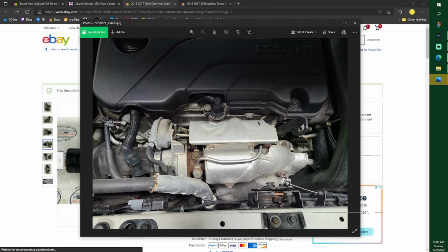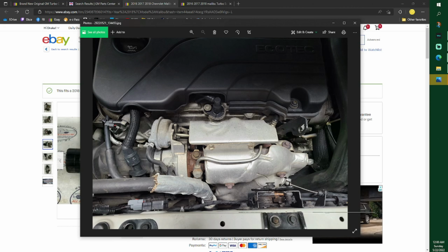And the whole problem I had with doing this entire car was this line right here, this AC line. It does not move. It may move a quarter inch barely. And also, you do not want to hit your sensors up here. There's a sensor on both sides. That is your airbag sensor. If you crack that, it's going to explode your airbags. So unplug whatever you need.